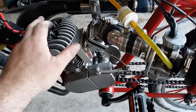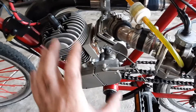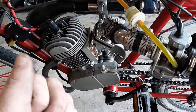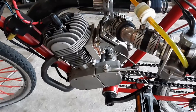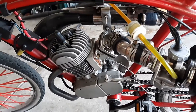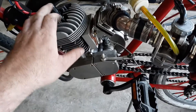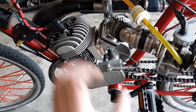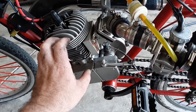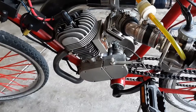Then I looked at the bottom of the spark plug and realized it had melted. But the engine temperatures never exceeded 342 degrees, which is below the average 350-degree range for two-strokes. I can't figure out what would cause the plug to melt — maybe cheap materials. It almost seems like it warped and changed shape, so it was not an overheating issue, even though it looks like one.